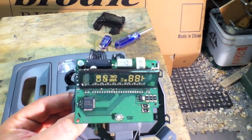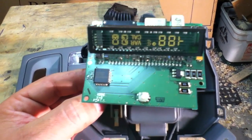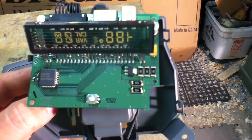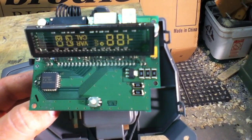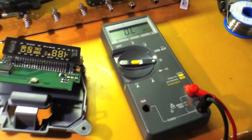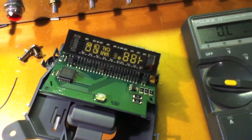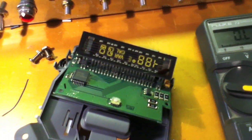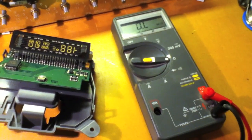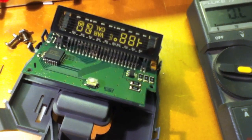I also took my multimeter and went through all the resistors just to make sure they were conducting, and checked for any visible evidence of a burnt circuit board, a popped resistor, or anything to that effect. I changed the dial to ohm reading, then took the probes and went through all the little black rectangle squares with numbers on them to make sure they all had some type of connectivity. As it turns out, the 510 resistors had connectivity but weren't making proper contact on the circuit board.